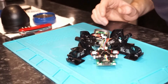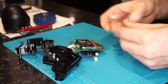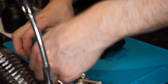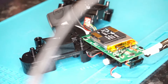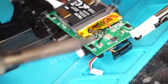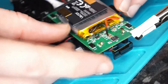We're not going to remove any of the actual housing - everything is still connected to the PCB. For the purpose of this video, to get the new battery in, we're going to leave the sides and back connected. I'm sizing up the new battery - the double-capacity 600 milliamp-hour that I normally use for Cosmo robots - seeing how it's going to fit into the Vector's chassis. The Vector battery compartment is actually a lot bigger; there's a lot more space. Whereas with the Cosmo it's quite a squeeze, in this case it's going to fit quite nicely. Fire up the soldering iron and disconnect the old battery. Be very careful when doing this because if that battery still has power in it, you don't want to rake it across any components on the board and short something. Get rid of the old battery quickly - it's not held in place by anything, it's literally soldered onto the board and clamped under the charging plate.